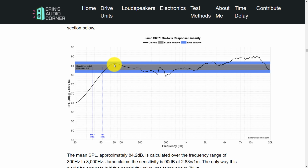So you don't have any harmonics from the 80 hertz to the 160. You're about 3 dB delta between these 2 points. The response dips below the plus or minus 3 dB axis from about 400 to about 600 or so hertz. And then it rises again through the crossover region, which is in here, poor directivity mismatch, and increases outside the plus or minus 3 dB window to about plus 5 or plus 6 dB in the treble compared to the mid-range. That's hot. I think this is probably where they're getting away with the quote-unquote detailed response aspect.